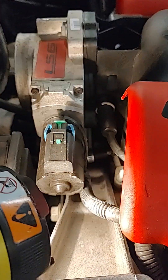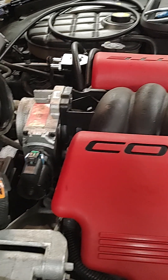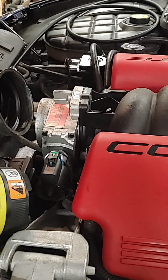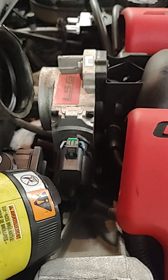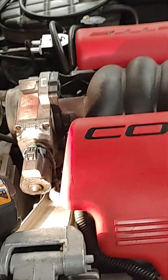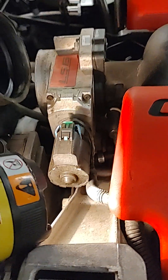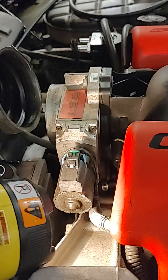The point of doing the coolant bypass here is there's a coolant line that runs through it — it heats up the throttle body and keeps it from freezing in sub-zero environments. Where I live it's not really a problem, and in North America not yet at least. Another reason you probably want to do this is so when you're at a car show or a car meet and you pop the hood, people are standing around and you can point and go, 'Oh yeah, check it out, I did the coolant bypass — it gives me an extra 10 horsepower, cooler intake charge,' or some crap like that.